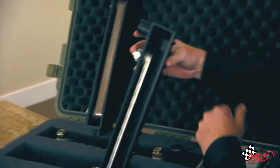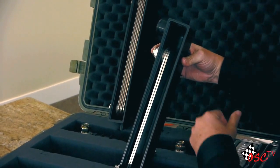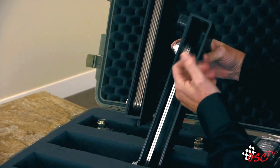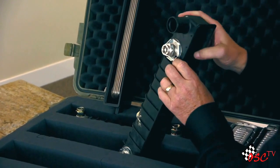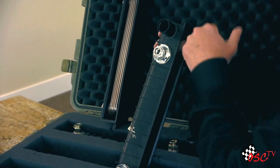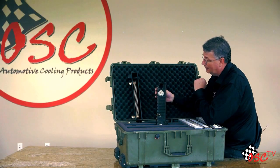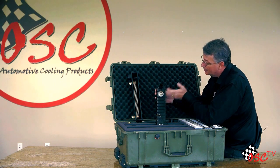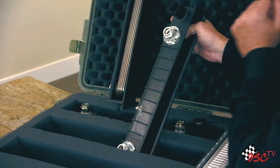Now on the VP brand, it's not a four plate, it's not a three plate — it's a two plate cooler. So it has half the cooling of the OE original unit. You're going to notice that they did use a GM power nut on the outside, but they put a washer underneath it for whatever reason. They don't mark it to let you know what it is, so if it's torqued in position or not, you just have to assume that everything's done correctly.